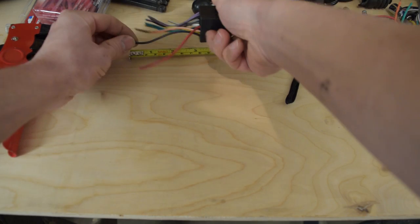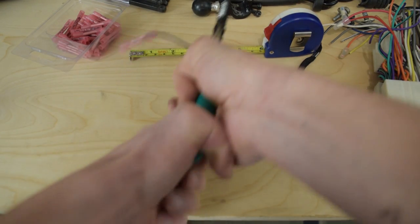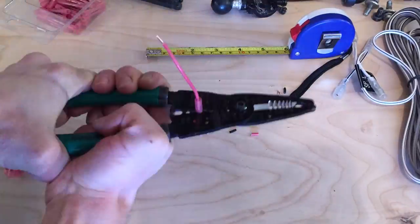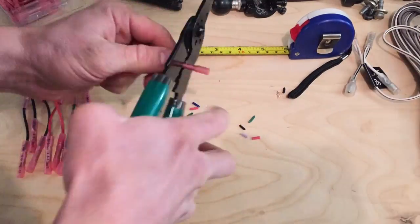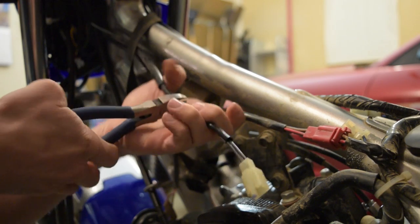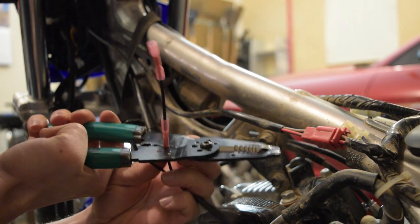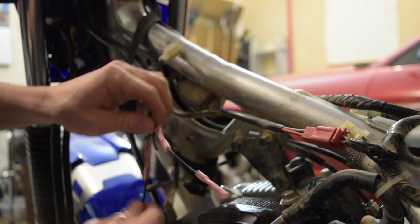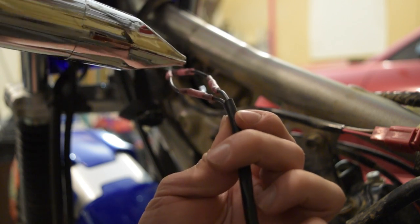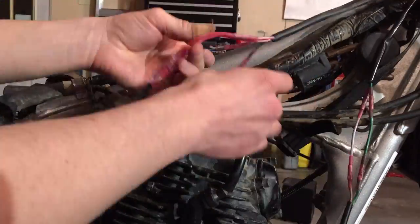Unfortunately there is no extra slack in the wires I can free up so I decided to extend them. I removed the two belts, unplugged the clutch switch wire and moved it up to see how much longer it needs to be — looks like 3 inches will do the trick. I'll be cutting 3-inch wires off an old stereo harness and stripping and crimping a waterproof red crimp on each end. There are 8 total wires I'll need to extend, so I'll need 16 crimps total. I'll try to match the colors the best I can. I'll unplug the connector, cut it off somewhat in the middle, trim back the sheaths, strip the wires, then crimp the extensions on. Make sure to tug on them so you know you have a good crimp, then use a heat gun to shrink the waterproof part — there's a glue inside that oozes out to give a perfect seal. Finish it off with some electrical tape and plug it back in, then do the exact same thing to the other wires.